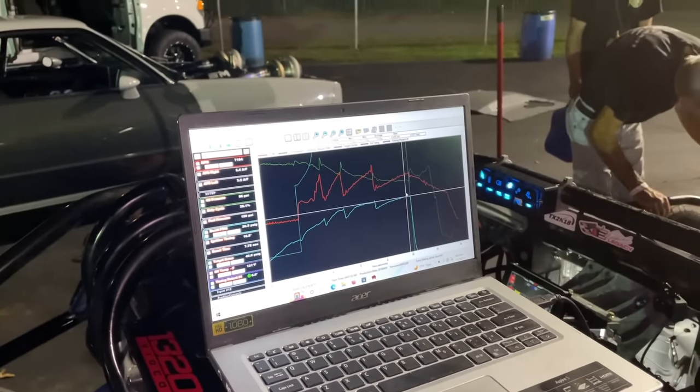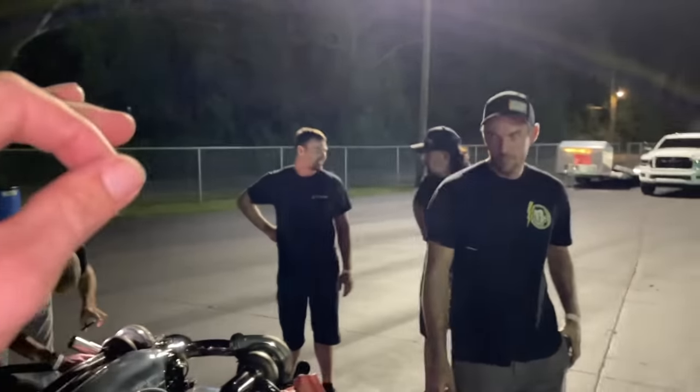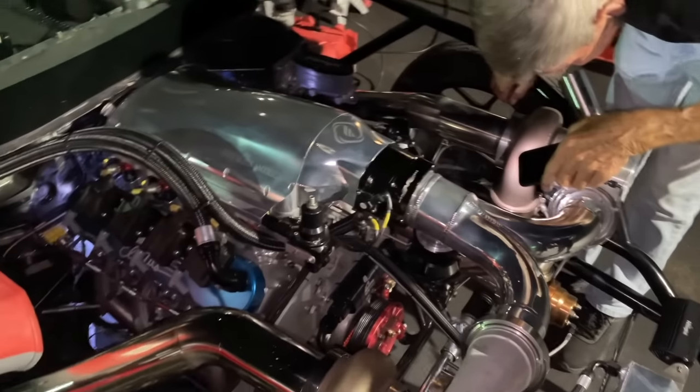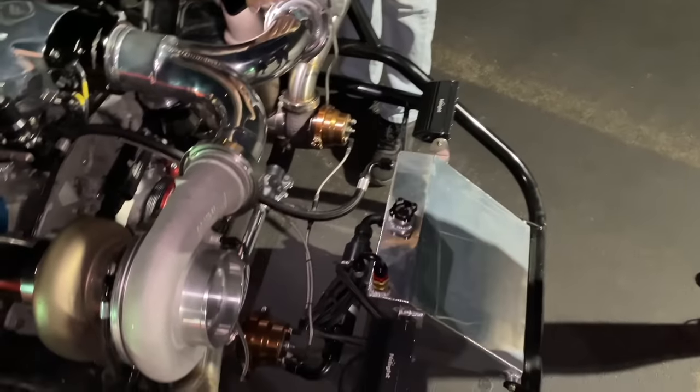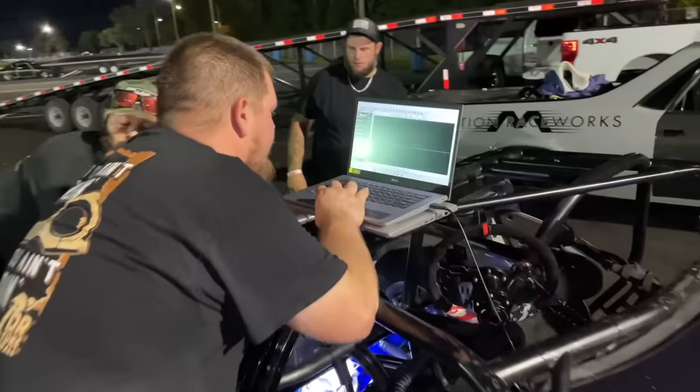What the hell, dude? Hey, I mean, that's awesome because we're figuring out the car without power. Yeah. Hey, made no more boost. 20 pounds of boost still. 20 pounds? Still didn't make a single pound more. So I wonder if our dome pressure is not what it should be. Our dome pressure is actually lagging behind, but we're going to figure it out.